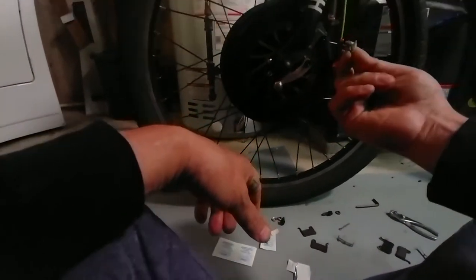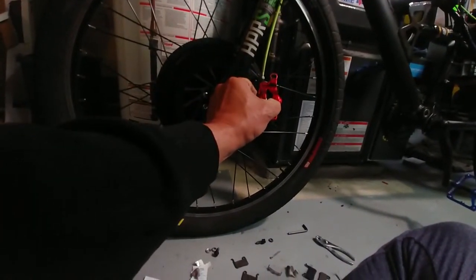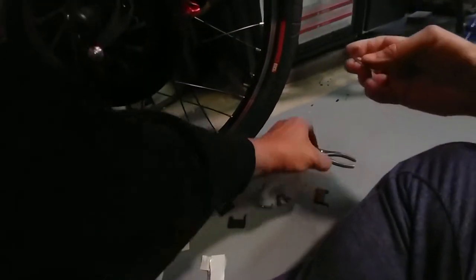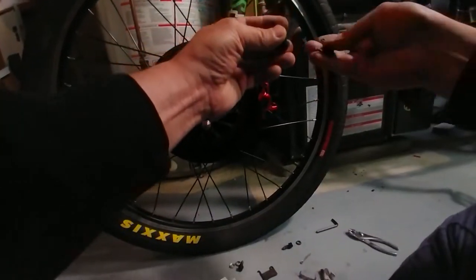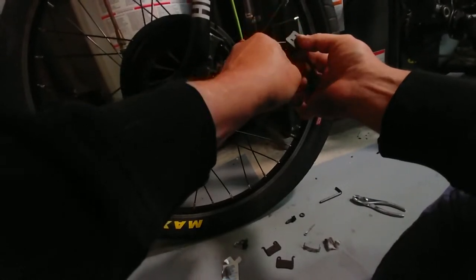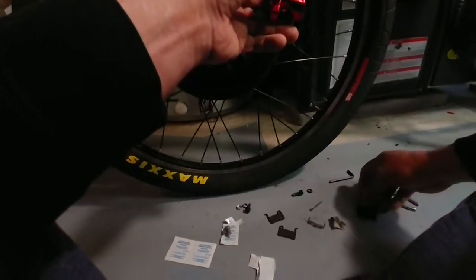And that's all it takes. Let's quickly clean this up, give it a quick wipe down. I've already checked that both pistons pop out — you can easily check just by putting your finger in there and giving it a squeeze. You can see they're both moving so there's nothing seized. This clip keeps them apart. The new pad goes in like this, and then you just basically slide it in. The cotter pin goes through the loop side there. I literally just saw a picture of them and thought they'd probably fit — couldn't even check the model number — but they work.